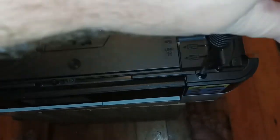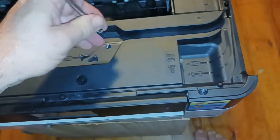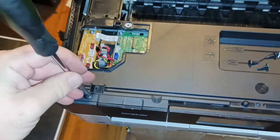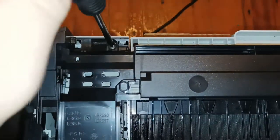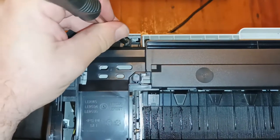Now, we're having a bit of a rush on these printers for this problem at the moment because it's just been raining continuously here in Australia for the past 4 to 5 months on and off. The ink absorber in this machine is designed to evaporate the water content out of the ink to make the ink absorber last quite a long period of time. And the problem is, because we've had all this rain for the past 5 months, the water is not evaporating out of the ink absorber pad, and so it's throwing up the error message saying it's time to replace the waste absorber.